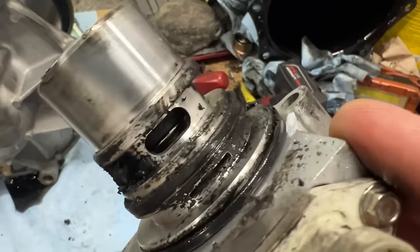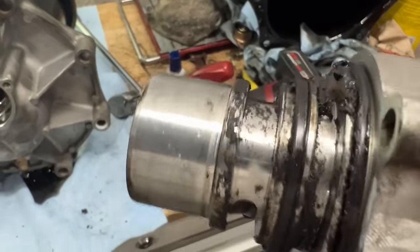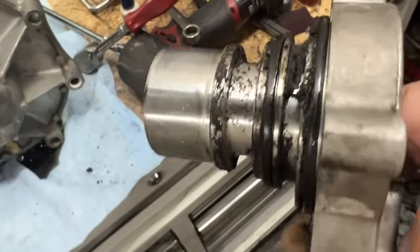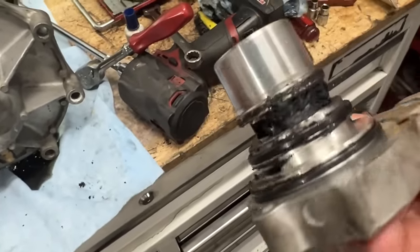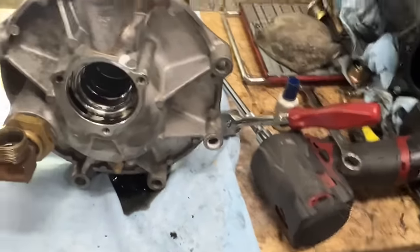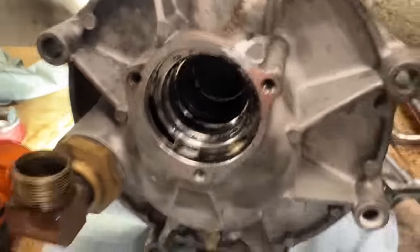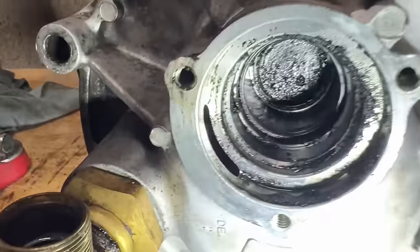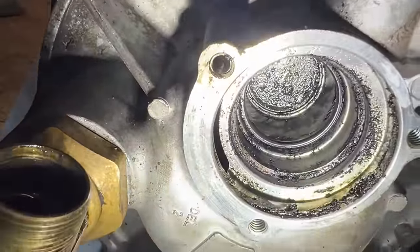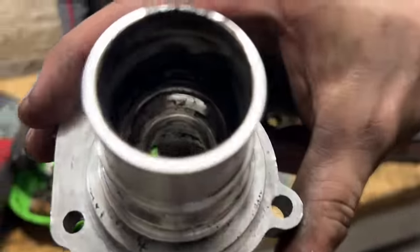All right, we're getting inside the air dryer here. I see why it's probably not working, is everything's so gummed up and caked up with debris and oil residue and cooked on oil. It's just nasty. So nothing's working in here. We're gonna get this all cleaned up. We're gonna replace the purge valve on here, rebuild it, all new O-ring seals, get everything cleaned out. This is an AD-9 style air dryer, but it's so gummed up and caked up, it's nasty inside. We're also gonna put a new desiccant filter in it as well.